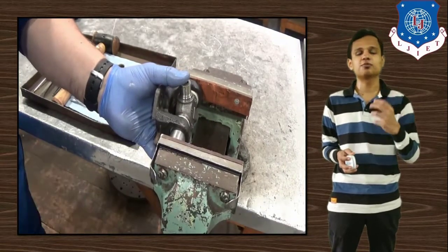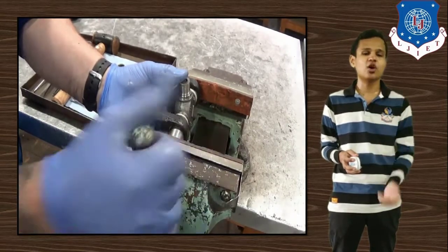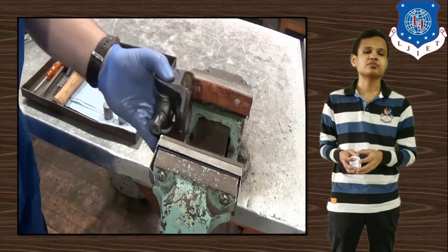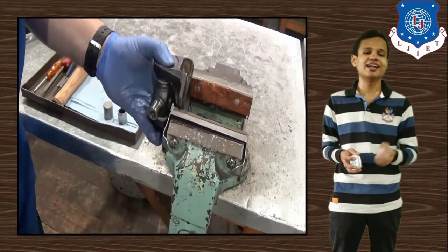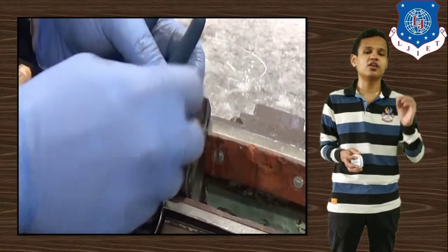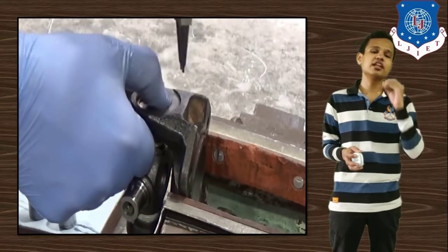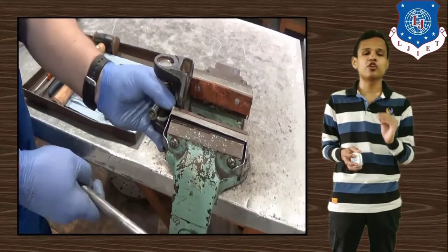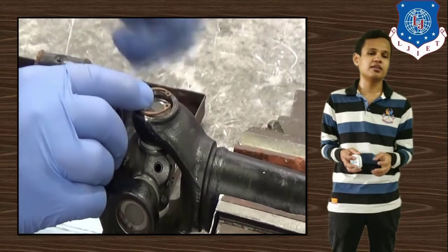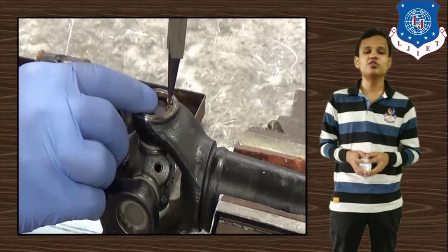By just keeping the cap, he will push the spider inside the cap so that one cap fits to one side, and in that way all the caps will be installed to the spider once again. This is how the assembly of the universal joint is done — the same as the opposite procedure of the removal. This is simply handwork with just a little bit of help from the press. After completing the cap on all sides, the snap ring will once again be fitted on the spider end. You push the two ends and the snap rings fit in place, giving the proper fitting. This is how the overhauling of the universal joint can be done, and after completing the assembly it has been attached again with the propeller shaft with the snap ring fitted in all four spiders.